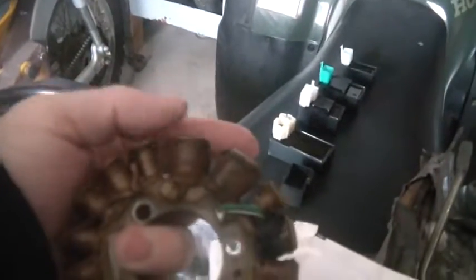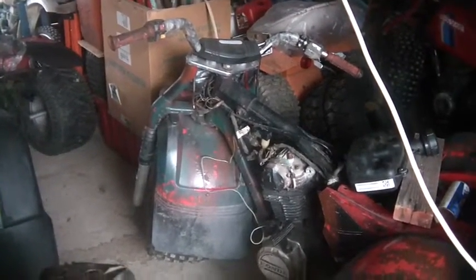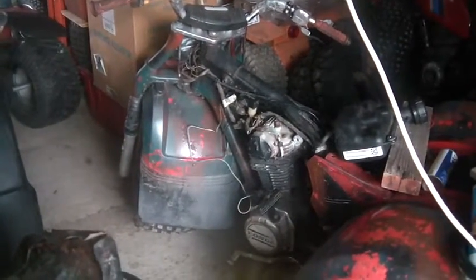The stator actually looks like this coil here. On the big ones — this is a 200cc — it actually just uses a couple of these coils, those two big windings. This unit is cheap, no advance, AC powered, and it works on those bikes. To buy a new old stock CDI unit for these, it's not cheap — people are asking around $50, and even a used one you're not sure works is typically $29.95. I'd much rather buy a couple of these for nine bucks each.